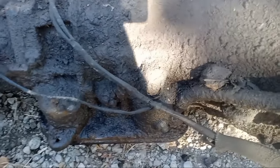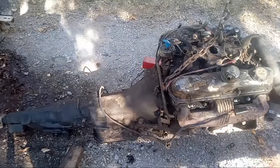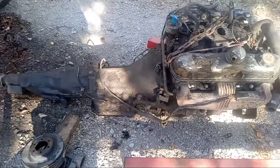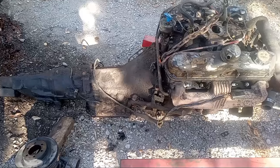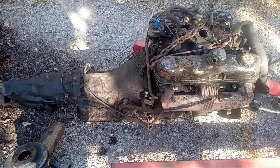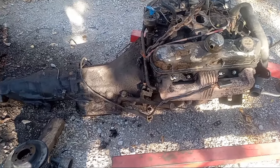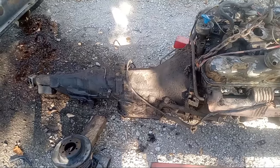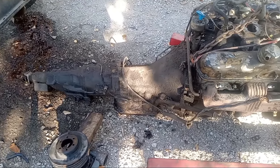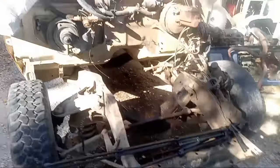So, I don't know. This being a 250 and all that, I would have expected a 518. But with Mopar, you never know. And I should have known when I redid the wiring harness when I first got the truck, it had a lockup. And generally, first year 518s did not, and 1990 was the first year for the 518. So we got a 500. I'm not too worried about saving it, but it's here if it's got a core. I mean, I got one in that Ram Charger that's unknown. But she's out.